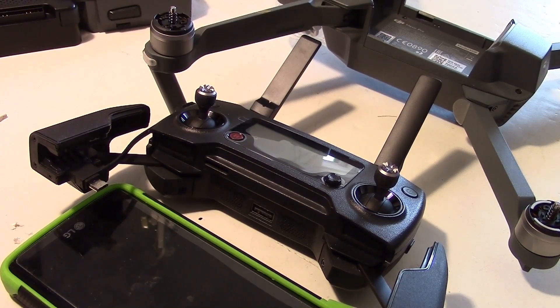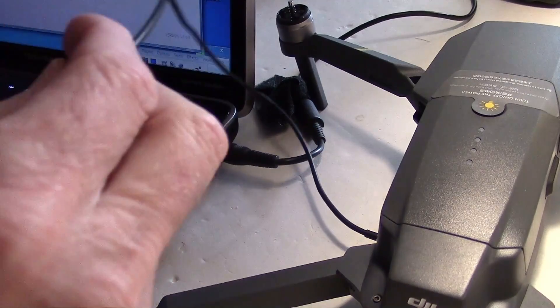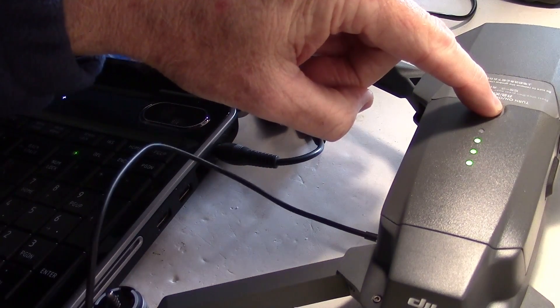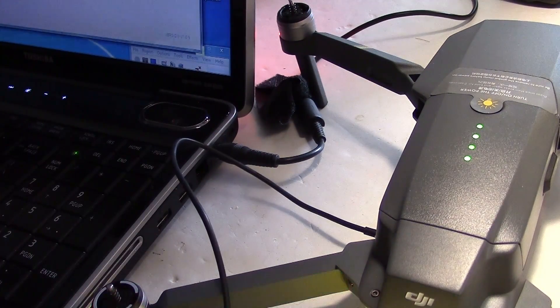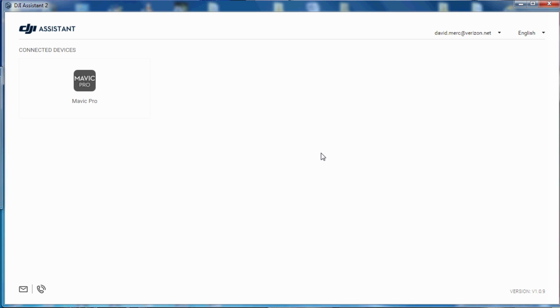Using the DJI Go app, we learned the firmware versions were all up to date on the three items. But for our own knowledge, let's take a look at DJI Assistant 2. The batteries are fully charged, so we're ready to go. I had a little trouble with Windows 8 — the driver just wouldn't install right — so I switched to Windows 7 and it seems to be working. First thing: turn on the Mavic, press the button once and hold it down until the rear light comes on, wait for the tones, then plug in the USB cable. The icon in the center changed.